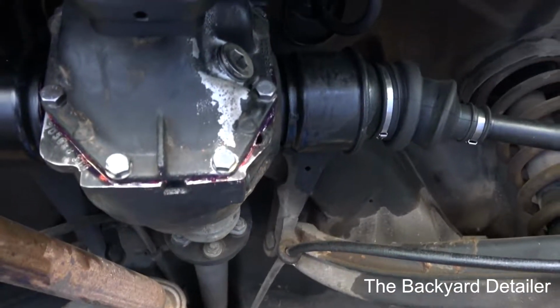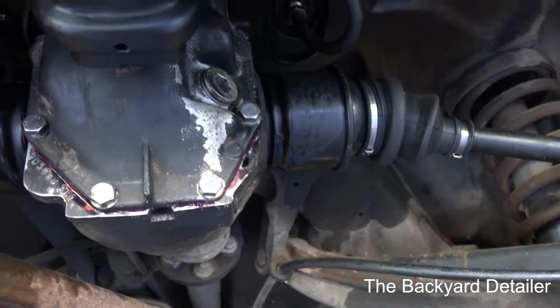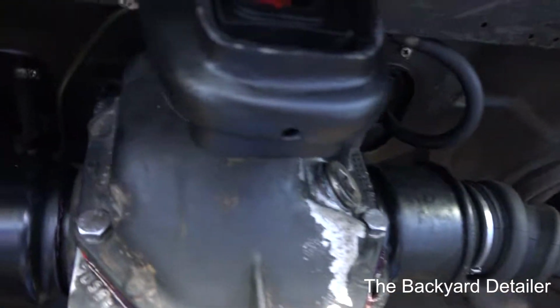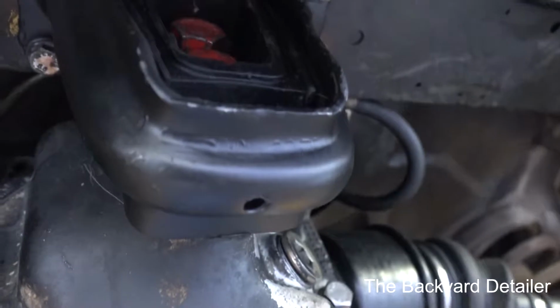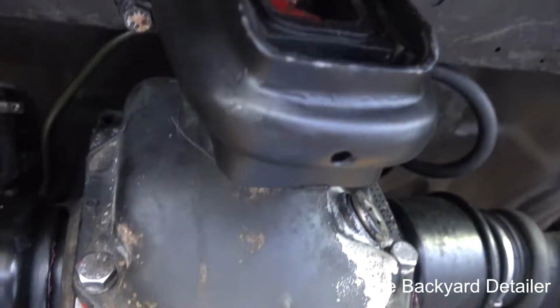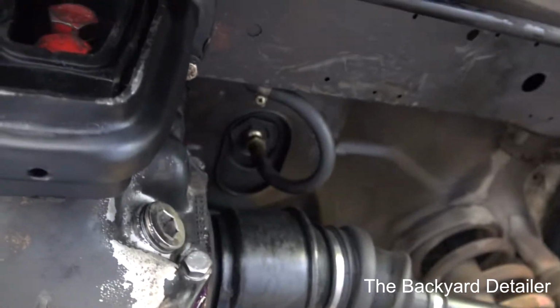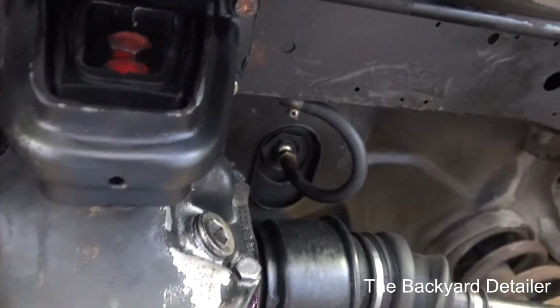And not only was that a pain, but getting the rear differential cover on, those top two bolts that I had told you guys about, I do not have my 15mm 1/4" socket yet. So I had to do it with the 3/8, which was hell all over again. I did put a new mount.